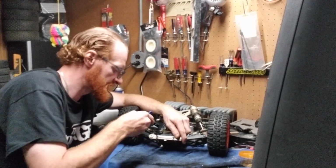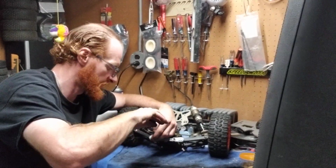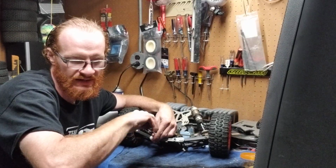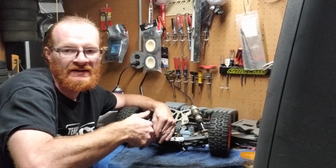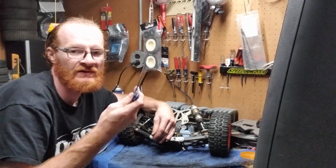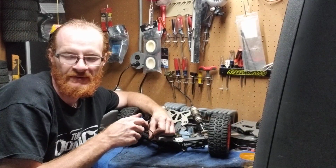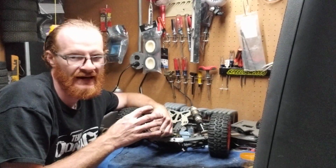And if it doesn't come out, don't use an impact, okay? This is something you can basically screw up very, very easily, and it's going to make your life horrible, because you're not going to have an easy way at all to get out a stripped screw, especially with this brace, without putting a cut in the brace or anything like that. So if you can, and you're working on a bench like I am, and you can use a T-handle, especially for this part, I would highly advise to do so, because this is one that you do not want to strip, because then you'll mess up your brace. You could mess up how tight the brace goes against the toe bracket, everything like that, and it all comes down to that.